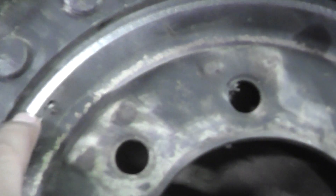Anyway, let me show you the process. I'm going to use this inner part of the wheel as a guide — you can see where the lathe was cutting. I'm going to take the plasma cutter, rest the tip right here, and just drag it using that as a guide all the way around.